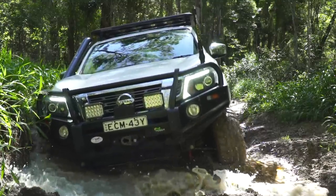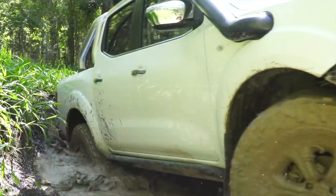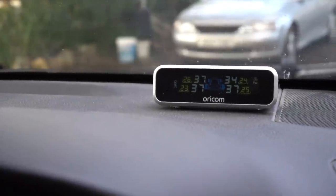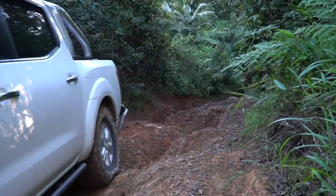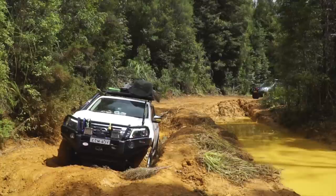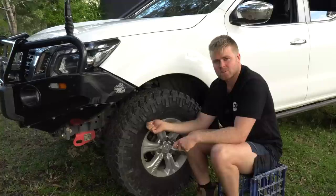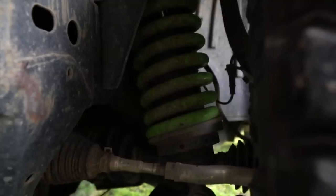The reason I've stuck with the factory rim is because I don't mind the look and it keeps the car looking quite nice and legal — not attracting attention with bigger tires and the lift, and it keeps the tires inside the guard without having to get flares. I also have an Oricom tire pressure monitoring system inside the rim, hidden away like a normal cap, with a display monitor inside the car that constantly monitors pressure and temperature of all my tires. For regular tough off-roading I think mud tires are the best; these are 10-ply and in four or five years of tough operating I've only ever busted one.